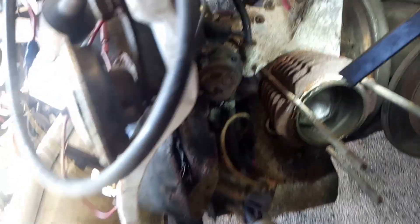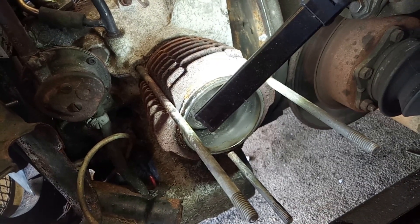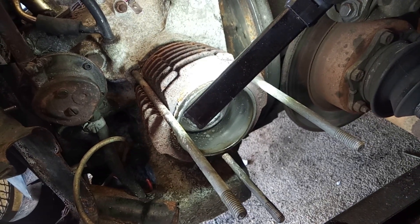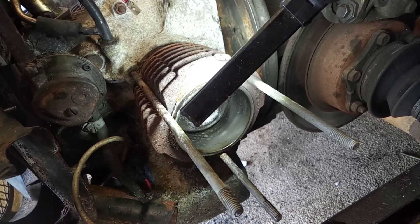Well, the news isn't good, having got our way in. Look at that water staining in the bores — probably not desirable. You can see a hint of honing mark in there, oddly just in one direction. Yeah, that's not ideal.